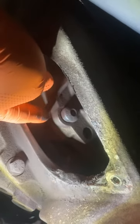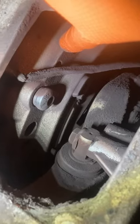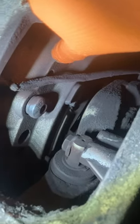So I removed those two 13 millimeter bolts and this access plate just slides off. I went ahead and moved the grease tube out of the way. This is damaged, so you wanna make sure this is taking grease because it's important to keep that throwout bearing greased up. But as you look into here, you'll see two things. This is your clutch assembly. This is an Eaton transmission with, I do believe, an Eaton clutch. And that disc right here is your clutch brake.